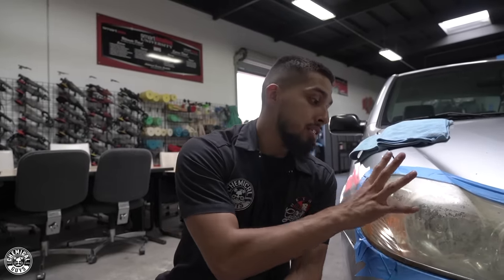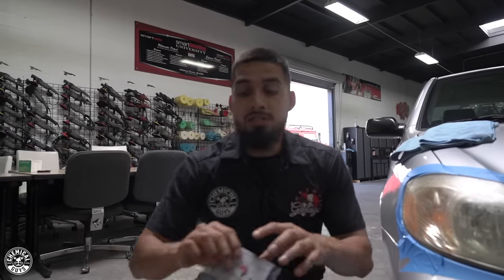A common factor is you drive a beater, you don't care about it, and over time your headlights can possibly turn dull. They don't shine as much or you can't even have any light going out of it. We always recommend having the best visibility during the daytime or nighttime. So before anything, you always need to clay the headlights before wet sanding.